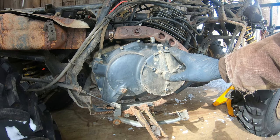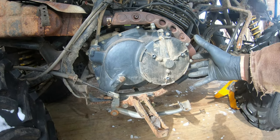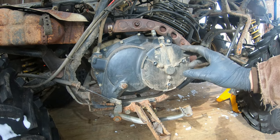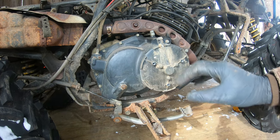I think the plan of attack is going to be from this side. Behind here should be the clutch. Yes, this clutch. Can I take this whole side off and inspect and see if that clunk is somewhere in and around the clutch area? If so, then I don't have to pull the motor - maybe I can repair without.